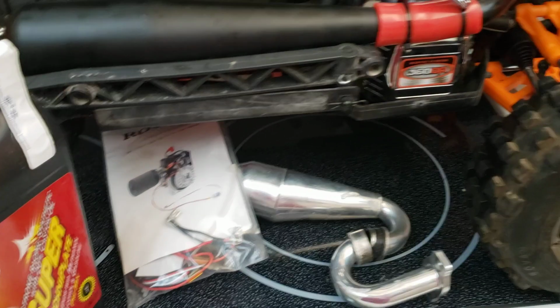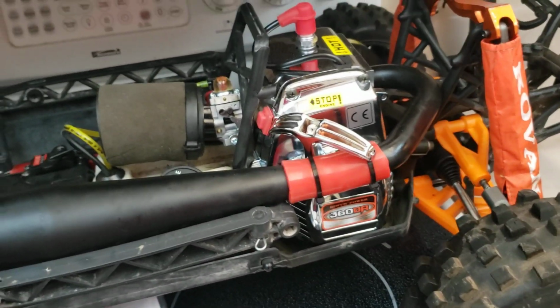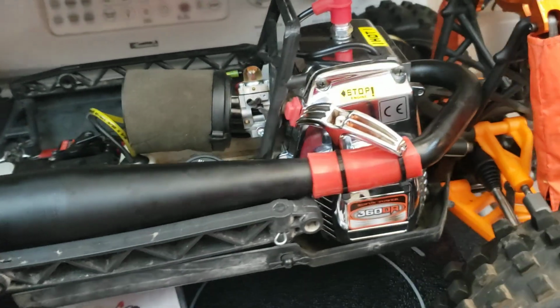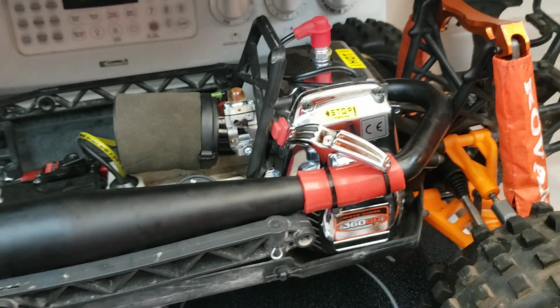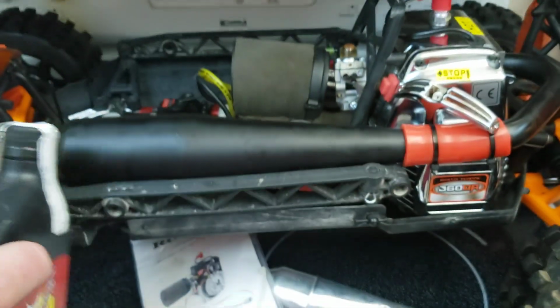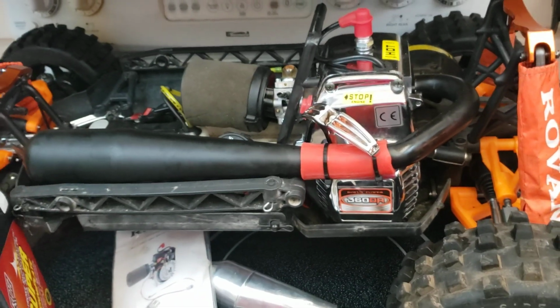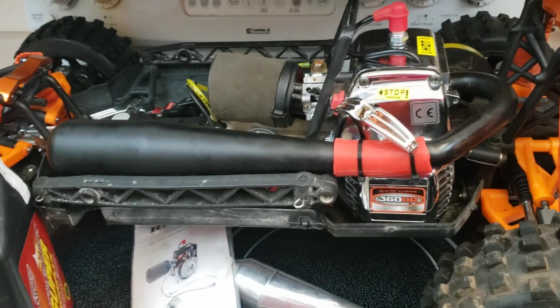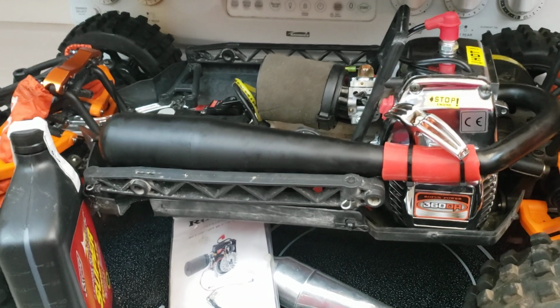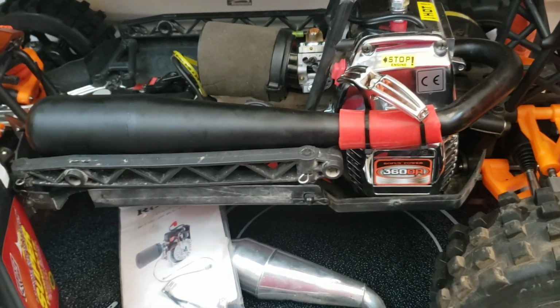And a lot of people ask me what I mix my two-stroke stuff at. For equipment like chainsaws, I mix like 40-1. And for stuff like this, or dirt bikes, everything gets 30-1. And obviously I use this oil, usually. And the gasoline that I use is from Chevron over here in BC, and it is 94 octane ethanol free. I know, because I've gotten that question a few times, but yes, I use ethanol free fuel. And a little shot of Sta-Bil fuel stabilizer, and then mixed to whatever you want. So, that's my own brew.